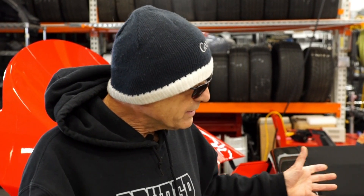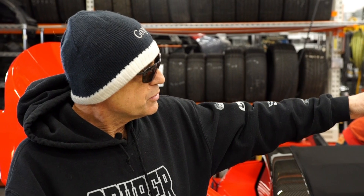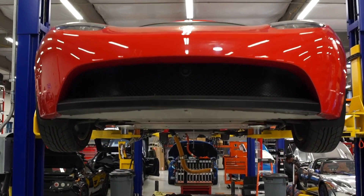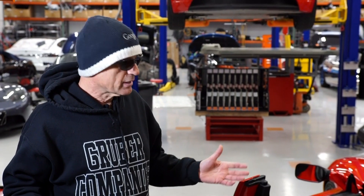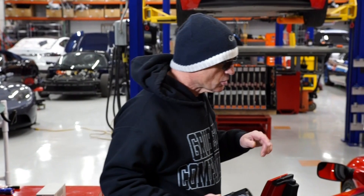This car will definitely now need a level 2 battery recovery, comparable to that radiant red Roadster up on the lift there. If we didn't have a dead brick in this ESS pack, after a level 1 recovery we would now be able to proceed with a normal charge.